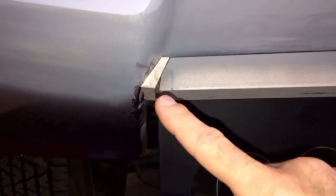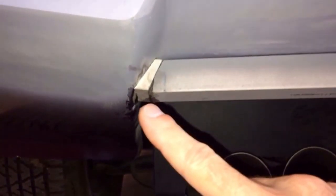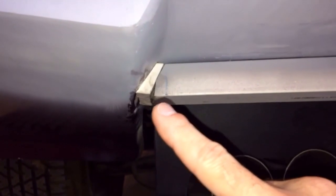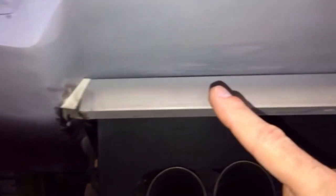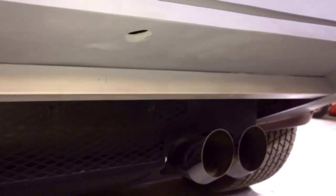Here's the extra piece I put in to fill that gap. The resin is hardening, holding that together. Once that's done I'm going to go ahead and put some body filler, blend that nice, go along that line as well to make it all look like one whole piece. Then we'll go ahead and lightly sand it down and prime it.